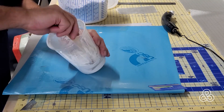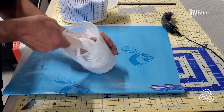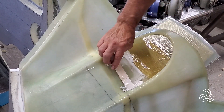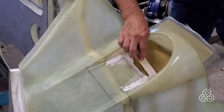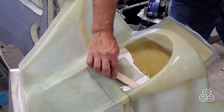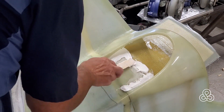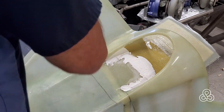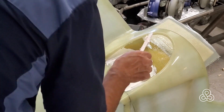Added a couple of fiberglass layers on there as well. Once those are ready to go, we're going to fill the little gaps with some microsphere-filled epoxy. Sorry this is a quick and jittery shot — the camera for some reason the white epoxy throws the auto focus off. Anyway, those gaps get filled for a later process. We'll go back, sand that, and put a few more layers on top before we flip it over and laminate the bottom side.